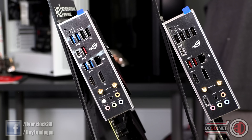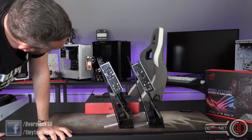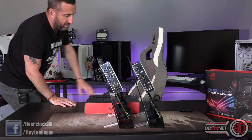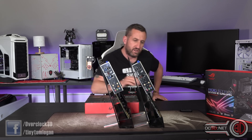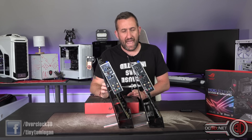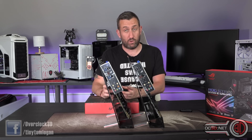With the F, you get two USB 3.2 Gen 2 ports, six USB 3.2 Gen 1 ports, and six USB 2 ports — or at least that's what's written on the box. Because when you look around the back, there aren't that many USB ports visible. So I'm assuming they might mean the internal ones too. Both boards have two internal USB 2 headers at the bottom.